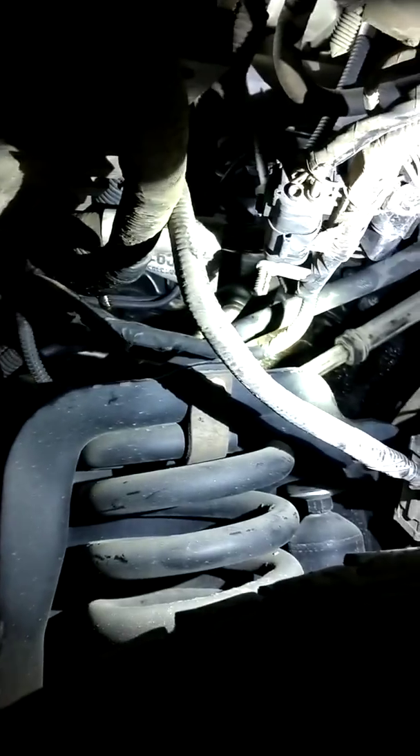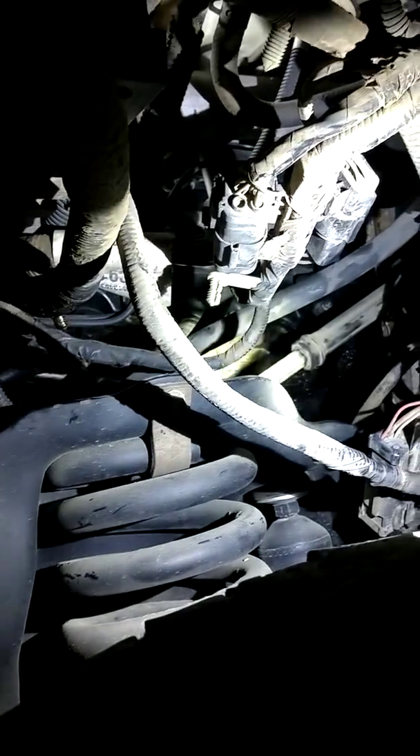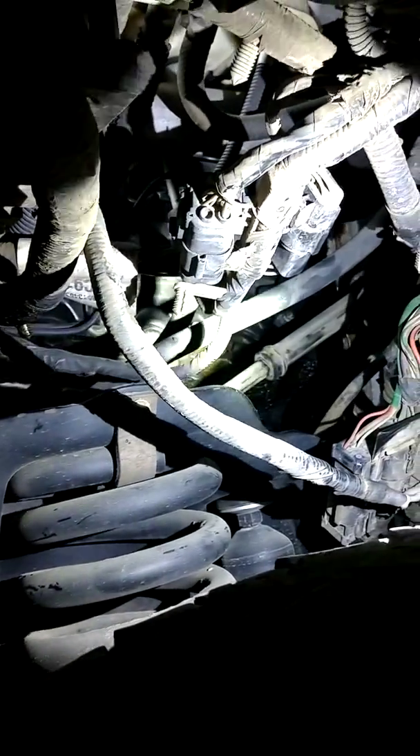What we're going to do right now is crank the engine over. Don't drain the fuel, don't do anything, don't pull injectors or nothing. You want fuel to maintain and stay inside the fuel rails inside the cylinder head. So Anthony right now is going to crank it to see how these cylinders are clean and free. Just pushing straight clean air.